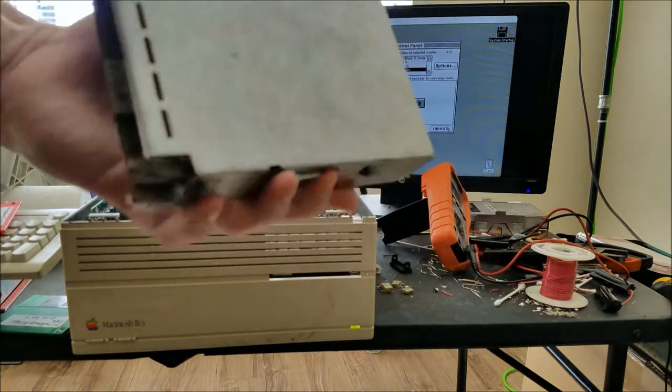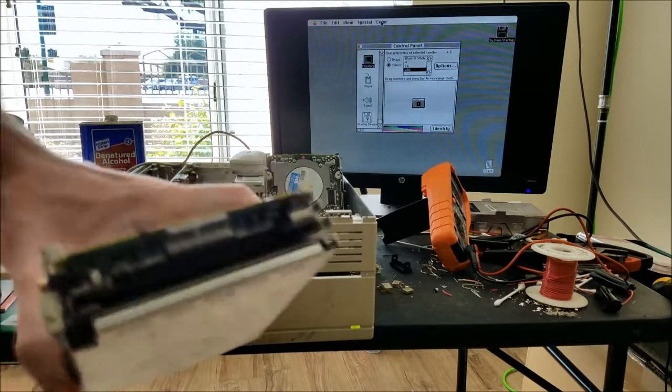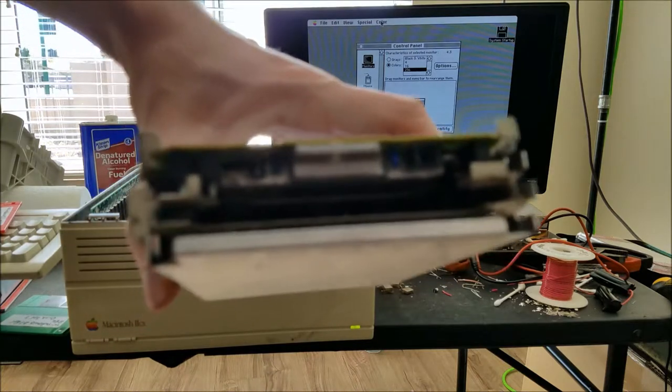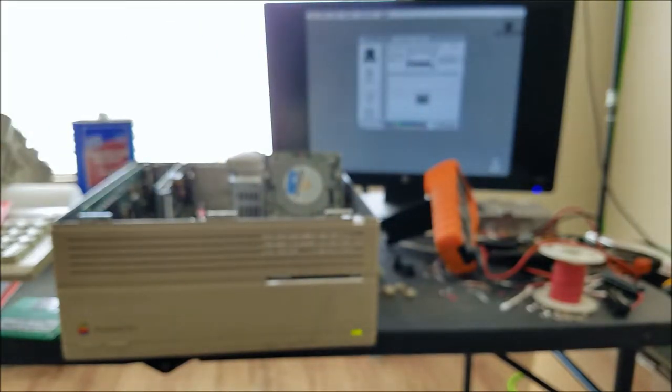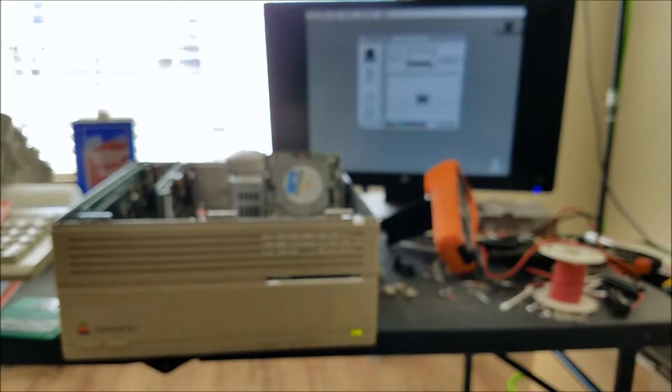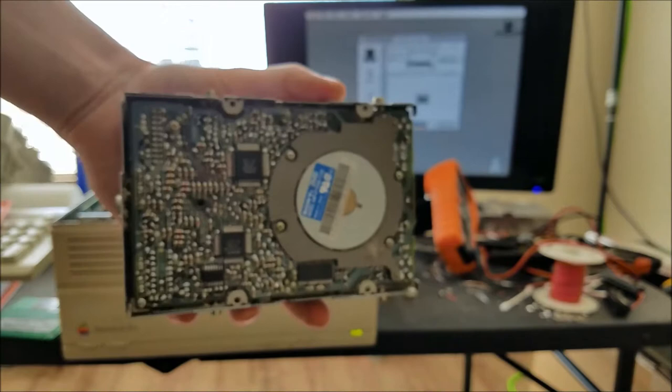This is the bad floppy drive that was in there. I could try cleaning the heads again. I can't see anything obviously wrong with it. You can look in there and see the capacitors are not the kind that leak - those are the kind that usually don't leak. I do see some tantalums in there, but usually tantalum capacitors just outright short. They don't usually go leaky like some of the electrolytes do. Usually when they short it just stops working completely. But this drive is actually trying to spin up - it does spin up, it's just unable to read anything. So it could be the heads are bad, or any of these chips on the bottom went bad.